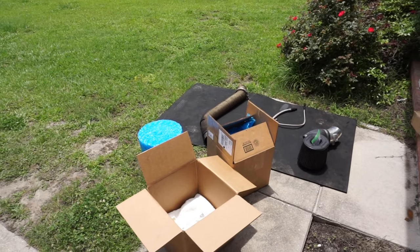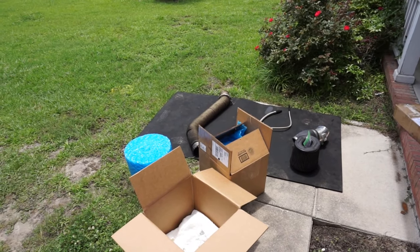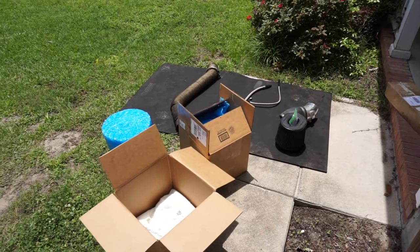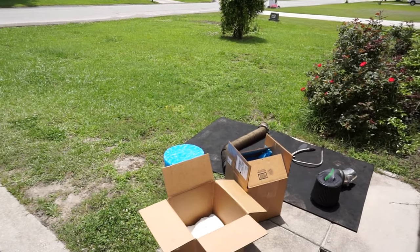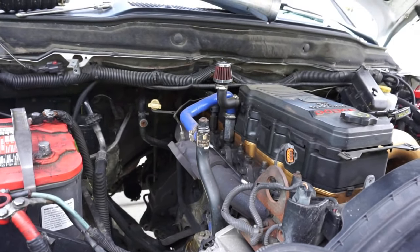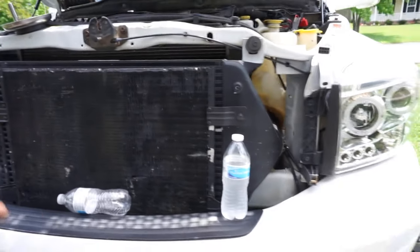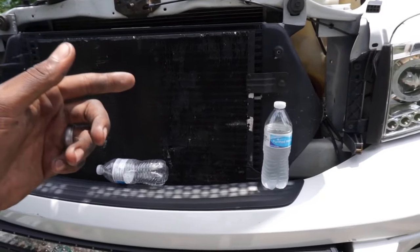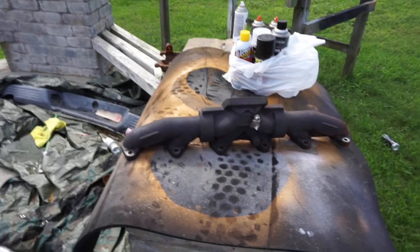That turbo has got a lot of life left in it. If I was a betting man, on a normal street truck with mild mods and normal driving, there's no reason that turbo can't hit 80,000 miles. Shaft play's on point — it's just a good turbo. The S467 on these 6.7s is a really good turbo and they sound amazing. So I'm gonna box all this up and then go ahead and take off that three-piece second gen style manifold, repaint it with exhaust manifold paint, install manifold studs, and flip it to the high mount position for the compound kit.